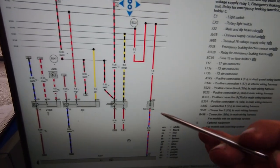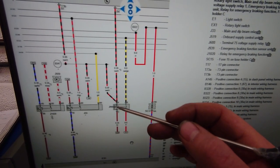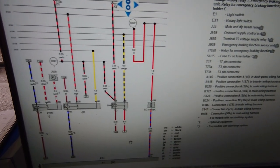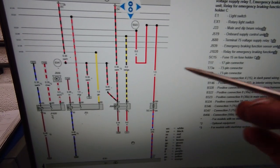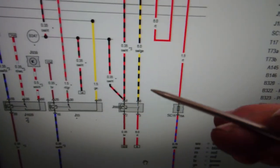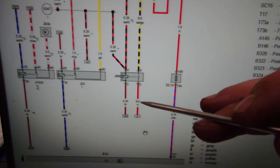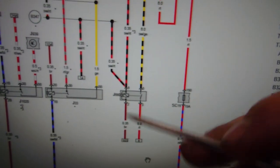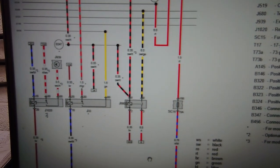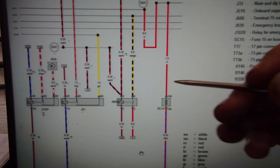I've done the hard work and found out where everything's going first. So this is a relay behind the dash — this is the one I want to get involved in here. This supplies my fuses that I want for the rear wiper, for the cigarette lighter, for all the other different things that we are missing in this car. We've got a supply in on this yellow wire and then obviously that goes off and feeds where it needs to be. This brown on pin two goes straight to earth, and we've got a supply in on this one.